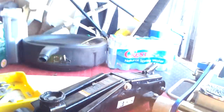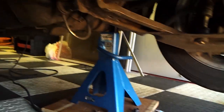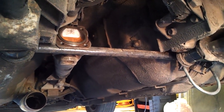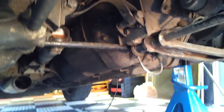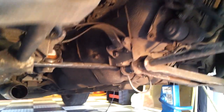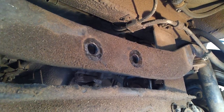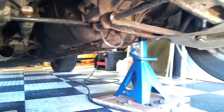Then I put two jacks together — one jack under the front end of the diff and one jack under the rear end of the diff. I unbolted the front differential mount, a big cross piece that spans across that the differential sits on. Then in the back, I finished unbolting those and pulled them out. I dropped the front end of the differential first with the jack, then started lowering the back end and had to inch it forward an inch or two, because those studs stick out through those holes. So you gotta lower the diff from the front end first, then push it forward about an inch until the studs drop out through those holes, then lower it all the way to the bottom, and then roll it out.